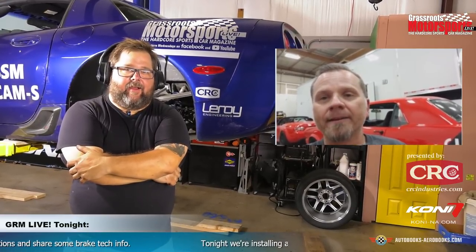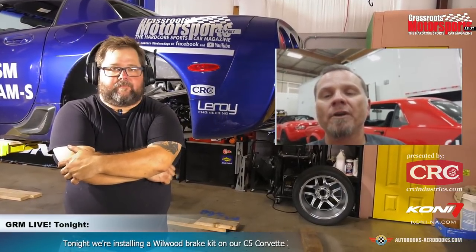To go a little bit further into this, what we'll sometimes do is work with a customer to figure out how we can put as much brake into the car, but not too much brake. You'll find some of the guys that say run the Optima series, like Mike Meyer in his 66 Mustang. It's over 700 horsepower, a Roush Yates power plant, but we're running literally the same brake in the front as we are in this Corvette. On the rear, we're only using an 11 3/4 inch, .810 thick rotor, because that car doesn't need as much rear brake since it's much lighter.